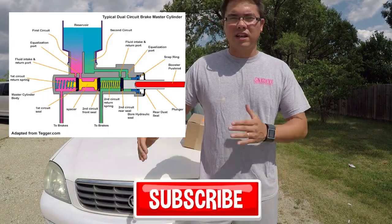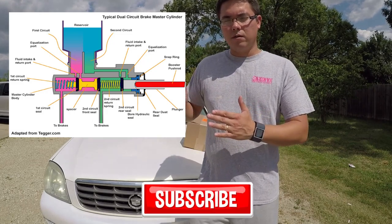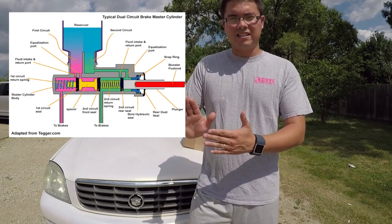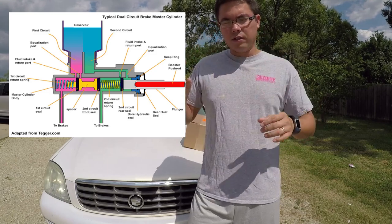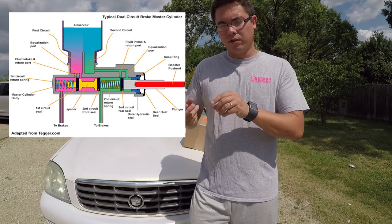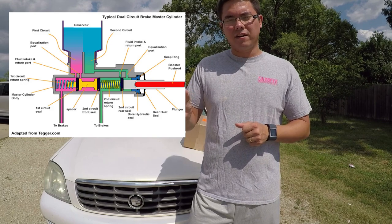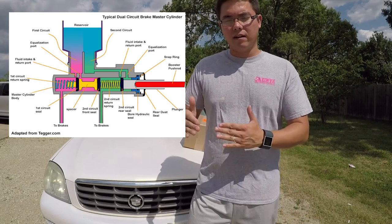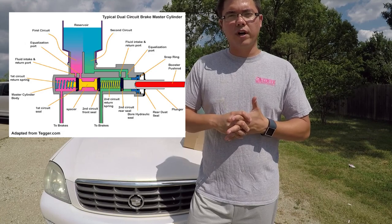So what is a master cylinder? A master cylinder is a component that is connected to your brake fluid reservoir that allows the pressure applied from the brake pedal to stay put against the brake calipers to stop your car. It's a simple little design — inside of it there's like a plunger piston rod assembly, and if your seal goes bad, it can allow your brake fluid to get past that and loosen up the amount of force you have applied to your brake calipers.